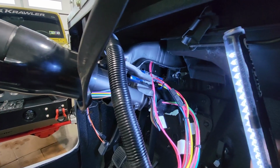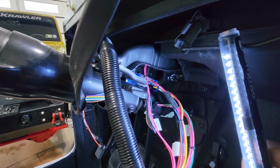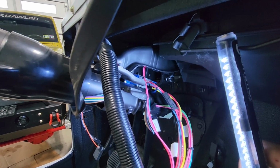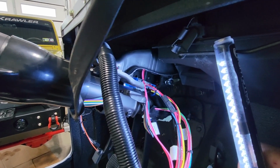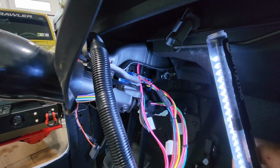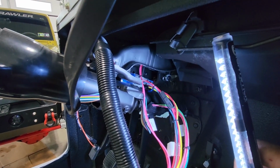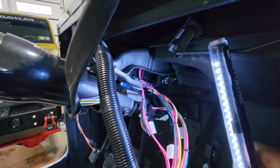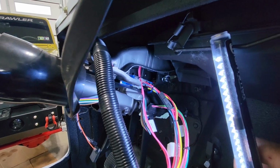They had just opened. The guy in tech I spoke to said, don't worry about it, just plug it in whatever way it fits. I guess that's a typo. He says they've been trying to get them to take it out of the instructions. So if you come across that, bottom line, just make sure you have the correct switch for your column and plug it in. The white one goes in first, then the black one.